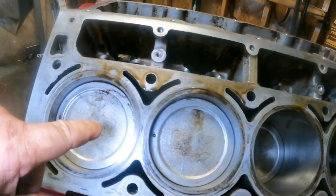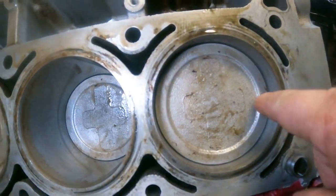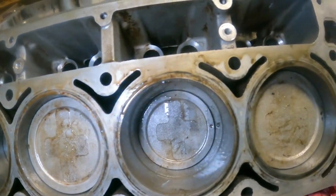I did watch that video, but I didn't take into account that he was talking about aftermarket pistons and rods and not the factory pistons and rods. So I actually had bank one in right with this little dot facing forward, but I had bank two with this little dot over here on all four of these cylinders. After watching some more YouTube videos and doing some more research, I realized that on the factory pistons and rods, that dot on both banks will face forward. And nobody caught it, or I don't know, maybe they did and they want to watch me blow this thing up. I don't know.